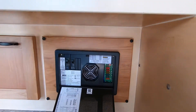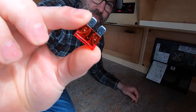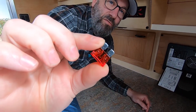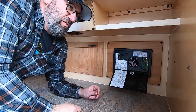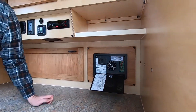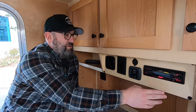You can see how that indicator came on — it's because the circuit isn't complete anymore, so the red blown fuse indicator will come on. You simply check the fuse; there's a little filament in there, and if that has a hole in it, your fuse is bad. It's a good idea to keep a few extra fuses on hand. You'll just replace the fuse by pushing it back into these tabs.